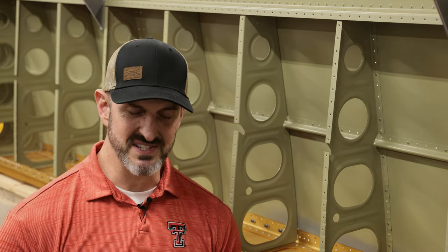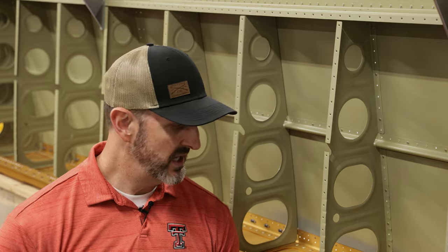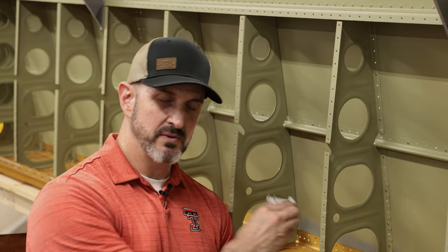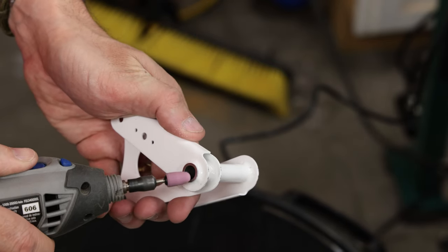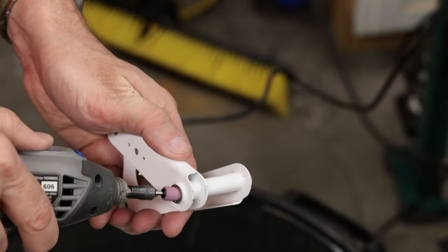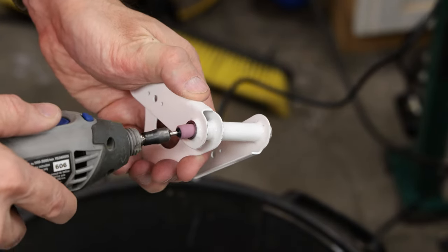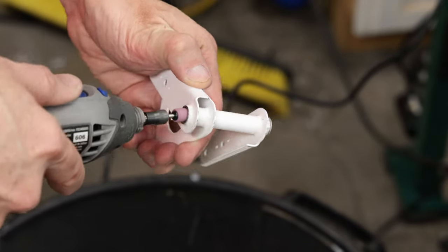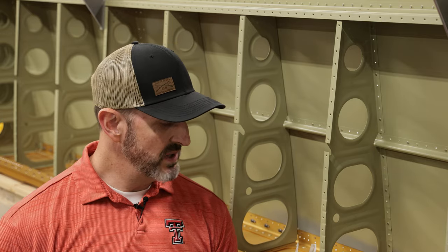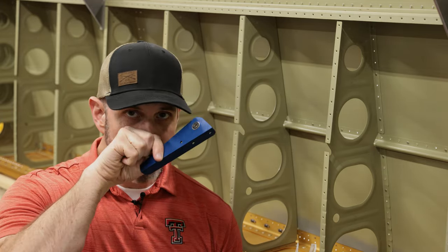Normally I don't use the same sandpaper on steel that I use on my aluminum parts, and so I ended up replacing it after doing this. After that, I used a Dremel with a grinding wheel to chamfer and smooth the ends back out so they can accept the bushings that need to go in there. Then I primed the inside of it as well as the bushings. Once you have that done, you need to remove the brackets from the rear spar.